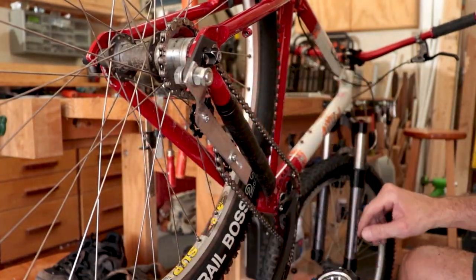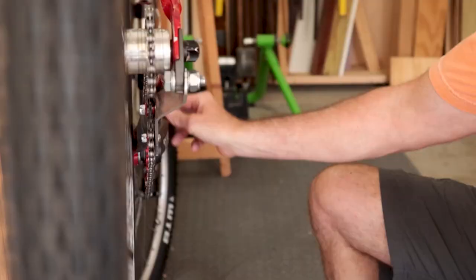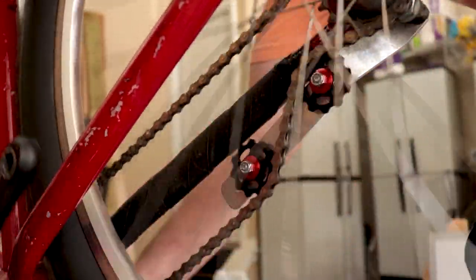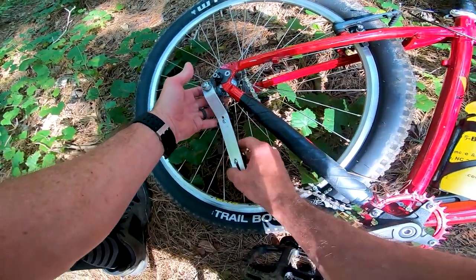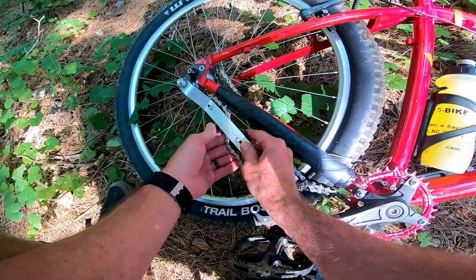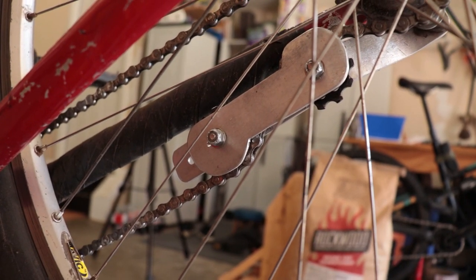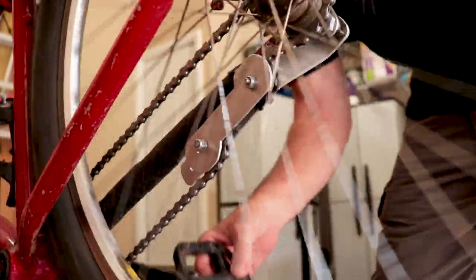I'll clean up the edges, sand it, and put it back on. On the test ride the chain dropped a few times off of the front pulley toward the wheel, so I came up with a simple solution — by adding a piece of flat stock to the back of the pulleys it completely eliminated the chance of the chain coming off. This was a fun and easy project and it works great. If you have any questions about the process go ahead and leave them in the comments below. If you like this please give me a thumbs up, and if you're like me and just refuse to act your age go ahead and subscribe.